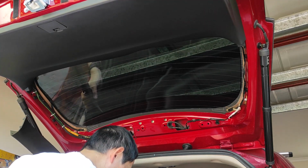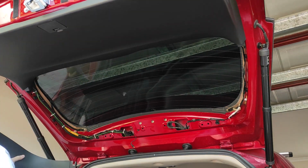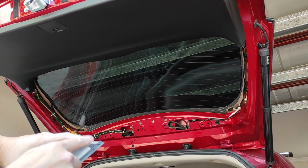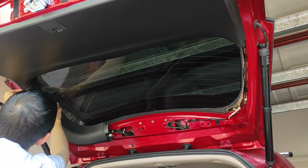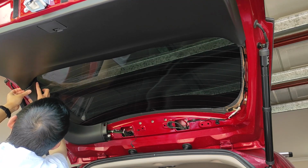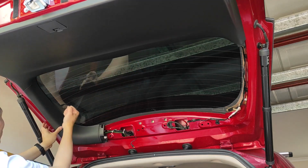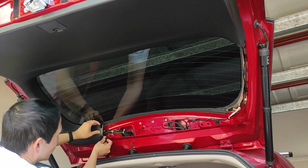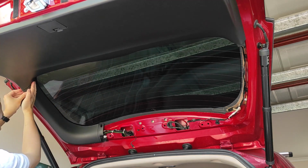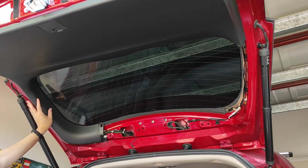If you're not sure, as you disassemble it, you usually put left and right on either side, so you know that this belongs to this side and the other one belongs to that side. So now this one, because of this tricky fitting, you have to line them up first on the bottom panel first. They are a bugger to push on. There. And after you line up those notches there, once they're in, you push that way, so the two clips go in. Done.